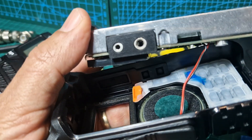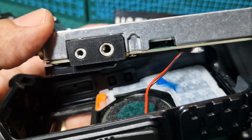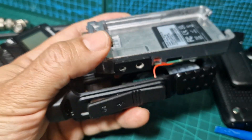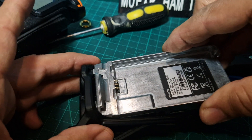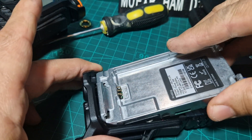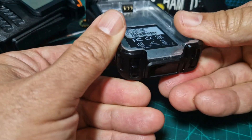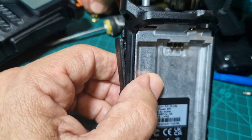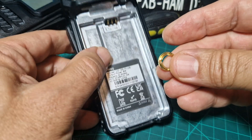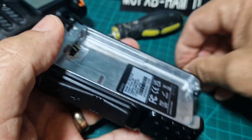The plastic piece that fell out just goes above the microphone/speaker plug connector - the right-hand hole is larger than the left. Just put that back on and slide it in so it's sitting on there. Then we're going to slide it under and in, and it just clips back into place. You don't even need to screw that ring back on, though it was very tight coming off.